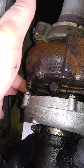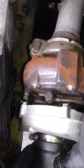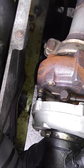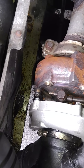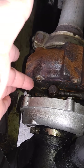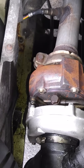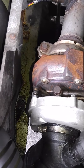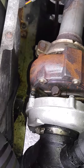He thought I got the wrong actuator, because I had one of these cheap GT2256V turbos which might have a different size actuator. So I went online, found on eBay a GT2256V actuator, ordered it right away. He says it's a little bit better — the original Garrett was over-extended, sticking out farther than it needed to be, past the wastegate arm. When he got the new one, he says it's pretty close, a little tight, but he got it to fit. Put it on, says your car is ready. Jump in it, drive about five or six miles — boom, limp mode.